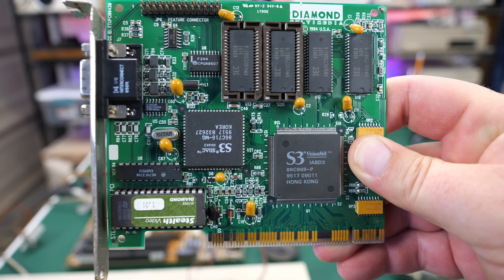Let's go to setup and see what this is configured for. It detected the hard drive already. It's got almost the right date — February 13th, 2022. I'm surprised that's working at all without the clock. Everything's set to auto, it's set for a 1.44 meg floppy drive, video EGA/VGA — this all looks pretty good. We've got boot sequence C then A. It's obviously getting to the BIOS. I'll save the settings, though I'm not sure the Dallas chip will actually retain them if the battery is dead.